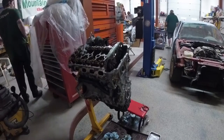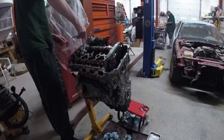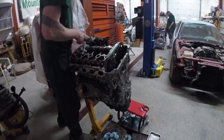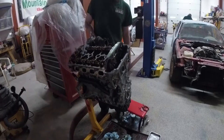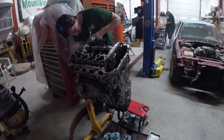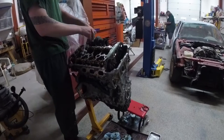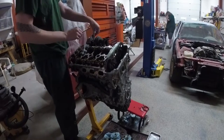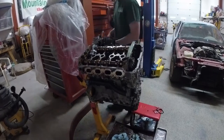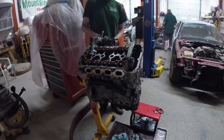Right now it's going to be a little bit of everything. I'm working on pulling off the timing set tool just so that I can start to turn the engine over and can finally make sure that everything is going to work the way it's supposed to before I put the valve cover on and actually spin it over with the starter. Because if you don't check it now, you're going to regret it. There's enough oil still in the engine and the cylinders that it's not a problem to spin it once or twice before oil pressure builds up — that's not going to hurt anything. You do this at the same time you do an oil change or anything of that nature.